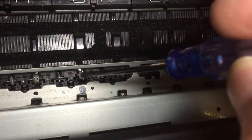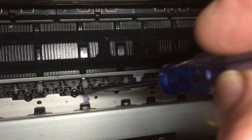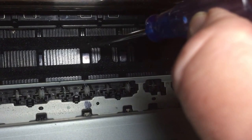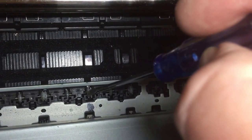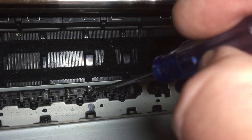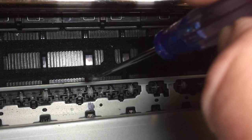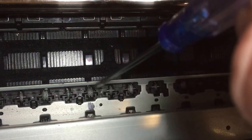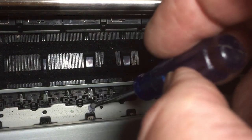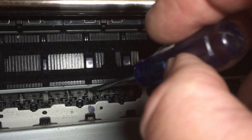This is a typical inkjet printer with these little rollers here. The rollers are spring-loaded and the paper comes through. In order to support the paper as it comes out of the printer, these actually put a little bit of pressure down onto the top of the paper to ensure that the paper can push out the exit of the printer. We've already marked which is the offending wheel — which is the problem.